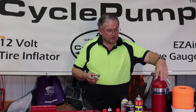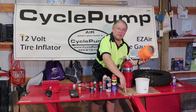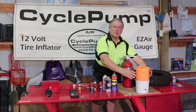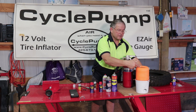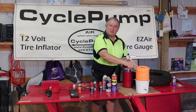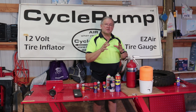Our test system here is a very simple set of plastic tubs. This is an empty plastic tub screwed down to a base. This is a big plastic tub with some nails in it — the purpose of those nails is just to hold it in the tub. We're going to shoot some different fluids in here and then ignite it through the touch hole, kind of like lighting a cannon. We're going to record how much this moves and try to capture the flame spread. We don't want a slow burn with visible flames — we want an instantaneous blast.